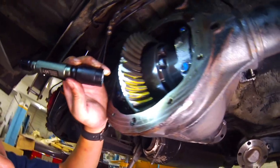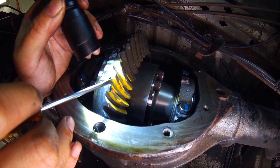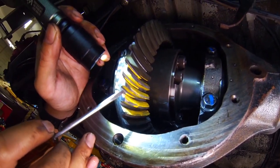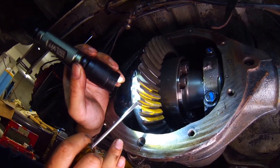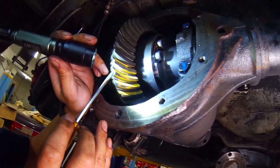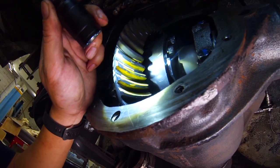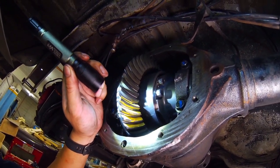Let's have a look. We're just looking at the mark - it's not as clear as we'd like, but in terms of the tip or the root, it's in the middle, fractionally towards the root. To raise the line up the teeth, normally you sink the pinion away - which we're not doing - but it's very close to the center. As it runs in the pinion will move away. In terms of backlash, the end of the contact patch is down there and the start is up here a little bit. We could potentially adjust that fractionally with the backlash, but it's not that far out that we need to worry about it.